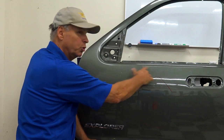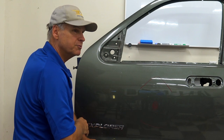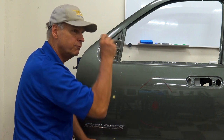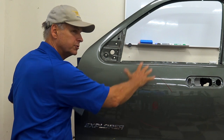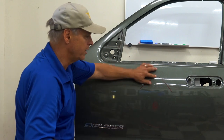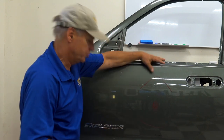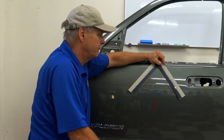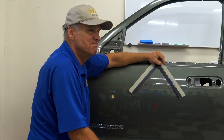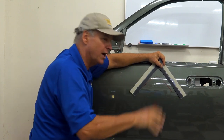And it's cool to watch your tension gauges. You're doing that, you'll see poof, like 30, 40 pounds sometimes, or at least 20. Just poof, gone, just from that. And what happens? You put tension on again, now it starts moving freely. And on a 90 degree, one time you'll probably have to do that, and after that she moves. Now a 60 degree crown, if they were all the way up here, you might have to do that 5, 6, 7 times. And the key is, guys, when the metal stops moving, you stop moving.